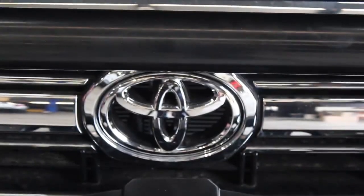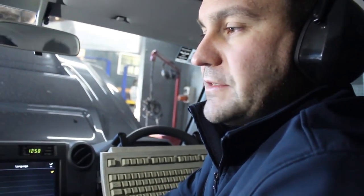I've got the laptop plugged in and we're about to do some live tuning. On a typical Unichip install, having already done a few standard runs, I'll do a zero map run — which essentially means the Unichip is all fitted but I have no numbers in any of the maps. So it still runs standard timing, standard fuel, boost, throttle, etc. This just gives me a good reference to make sure the Unichip and everything is working the way it should, as if the car was still standard.